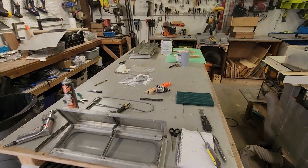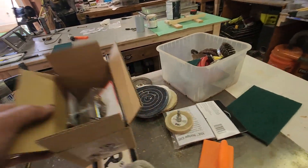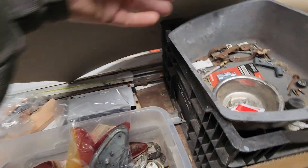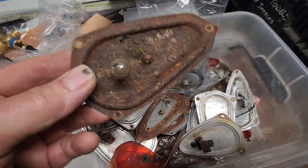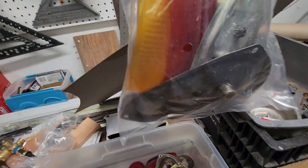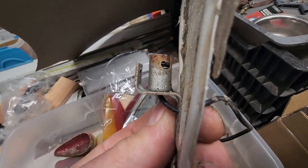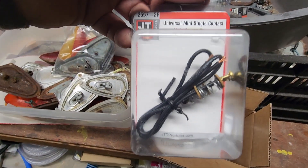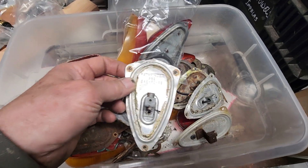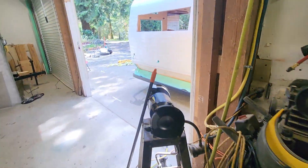That was just a quick walkthrough of some techniques I picked up from other builders, sharing them in case you're interested. I also found a box of vintage lights — this one's way far gone, but I was able to recover some. These are original Pathfinders. I found four that were really clean, polished them up, and saved the glass on them. Usually the center sockets are pretty well rotted out, but I found replacement sockets available about anywhere. I'm going to put new socket bases in and put original Pathfinder lights back on these campers.